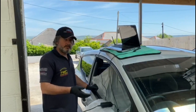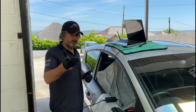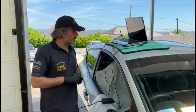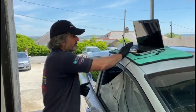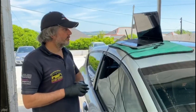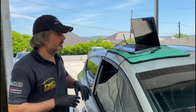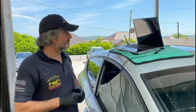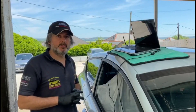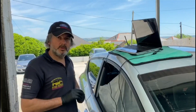Alright, the exhaust is all done — it's better heard than seen on an exhaust like that, isn't it? Exactly. So now we're installing the Revo software. What Revo require first is a superseded stock file, which is what we're putting on at the moment through various revisions, and then we'll go onto the Revo Stage 1 software after that. There's a bit of a waiting game for this because we've got to completely reconfigure it — you've got to do it twice effectively. Normally it'll just be one superseded stock file, but on these and a lot of the newer stuff, some of the last TSI vehicles and Mark 2 Focus models need a superseded stock file put on if it hasn't had Revo software before.